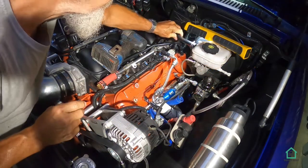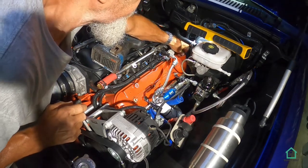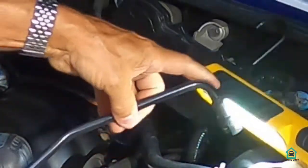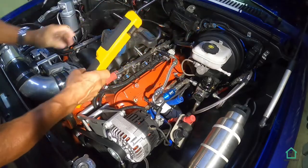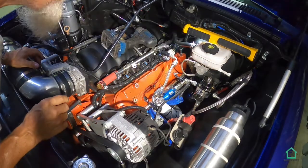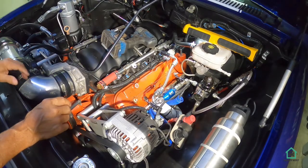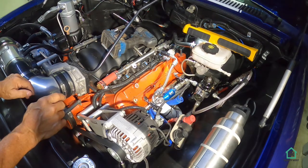and let's remove this PCV vent from the back. That's got a little clip in the back there. You can barely see it there. As you just push this little clip back, and then this vent tube comes off. Now that's going to have to be relocated. So as a part of this whole thing here, I got to relocate that. But we'll get to that when we get to that, right?